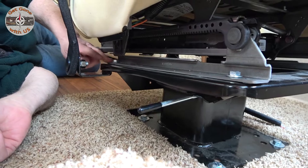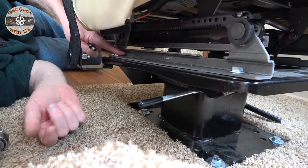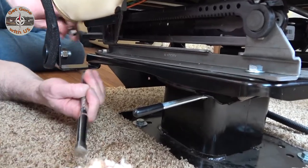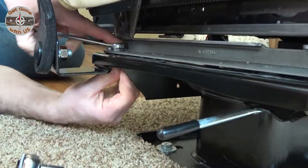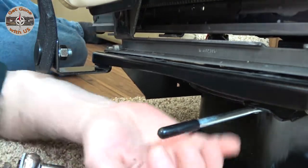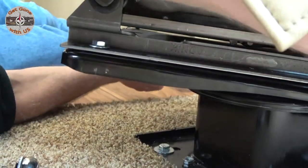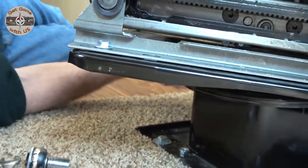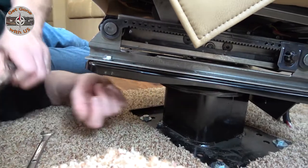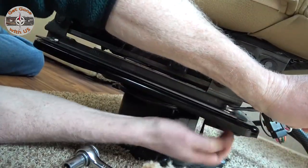Now back here, you have two bolts for the seatbelt. You want to remove the one closest to the front. So don't take the back one, in other words. All right, then release the seat, turn it around. Voila. Those are the other two. That's all that's going to be involved in this. All right, this is the last one.